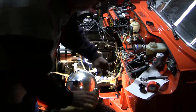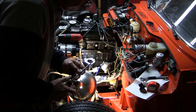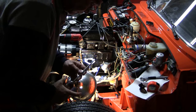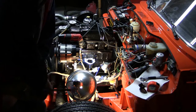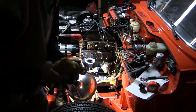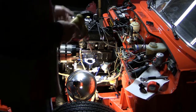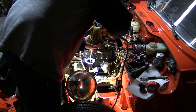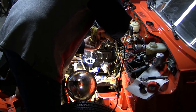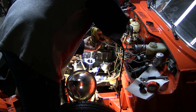Using the drill to drive the oil pump — here's a precaution: don't push down on the drill, pushing the oil pump shaft down against the base of the oil pump. That could cause premature wearing of the pump rotor to the oil pump plate cover.